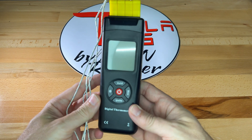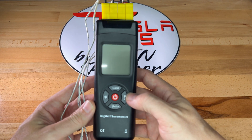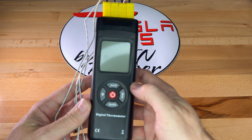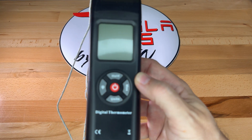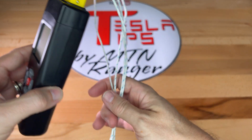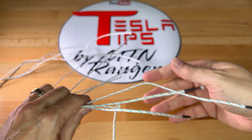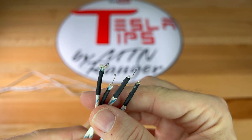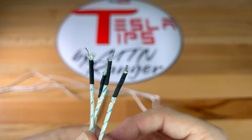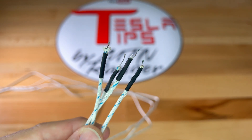This is a Tekko Plus 4-channel thermocouple sensor tester that I recently purchased from Amazon. What is neat about this one is that it can independently measure four different areas. During the tests, I checked the max temperatures reached during the three SSD tests, as well as when the PS5 is off and after cool-down periods. I found 30 minutes of cool-down to be a good amount of time to reach normal PS5 temps at the main menu.